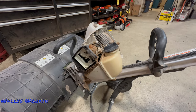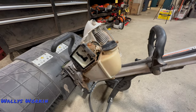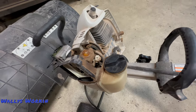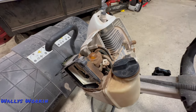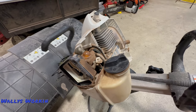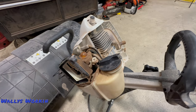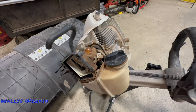If you are using these for artificial turf, you definitely want to be aware of that. It is a common problem. This is not Stihl's fault — this is just the environment it's being used in. We've tried different things over the years, like foam to pack around it, and it just never seems to work. So a lot of our dedicated commercial guys will pull these things apart and clean them all out every once in a while.